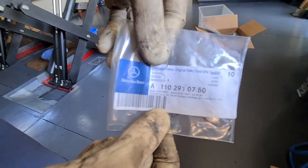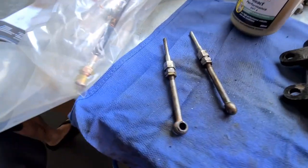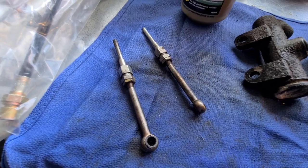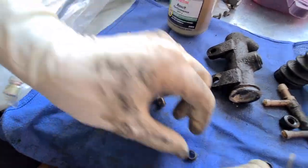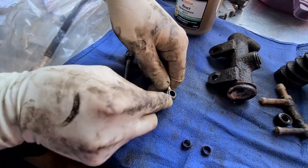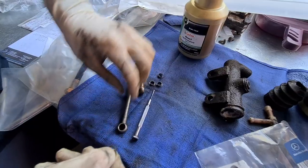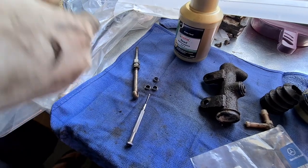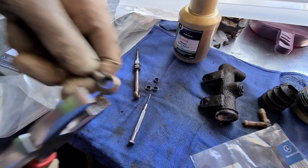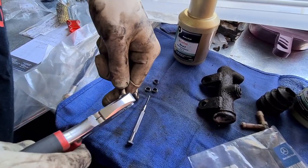These are the little new clips that go inside the connecting rods. Interestingly these didn't fit very well — perhaps I needed to clean the internals more thoroughly after getting the old ones out. Crimping them in was actually very difficult, to the point that I ended up using some of the old ones again because I couldn't get the new ones in without deforming them — they were quite soft metal. Just flicking the old ones out and putting a new one in — one on each side.